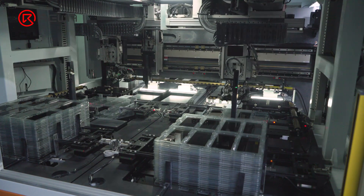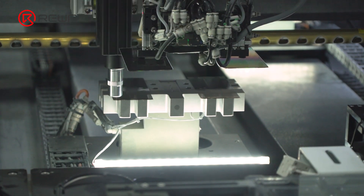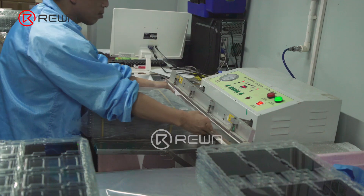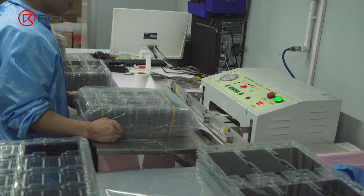Because different phones feature distinct cutouts, the laser machine cuts different shapes based on the unique look of each model. While cutting, the edges of the glass are also trimmed properly. The processed glass will then be vacuum packed and sent to the polarizer workshop for laminating.